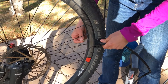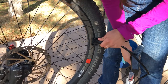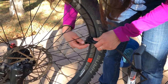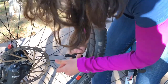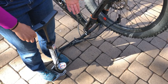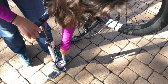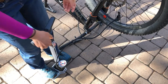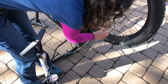Bike tires come with two different types of valves. One is called a Presta — that's the thin long one — and another kind is the Schrader. Oftentimes bike pumps will come with the attachment for both. So I'm going to attach mine to the Presta one here, make sure it's all the way in, and lift it up. Bikes lose pressure when they just sit there for a while, so my tires can go up to 50 PSI. Once I'm done, I just clip this down, take it off, and tighten the little bit back on.